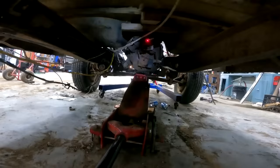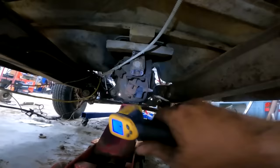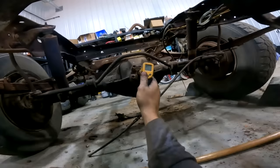I would say on the money. I got some blocks of wood jammed between the body and the floor jack, with the jack in the middle of it, so I picked up on it to pinch it in there, and I still have enough room between the floor and the output yoke on the tranny. So I got that room there, and it's about the right angle, pointing straight back towards this guy, to which I would hope Ford had this guy dead centered on the hanger bearing.